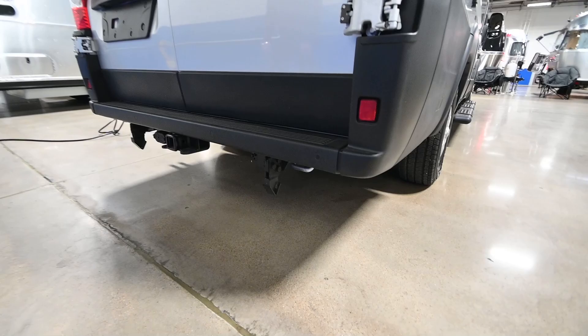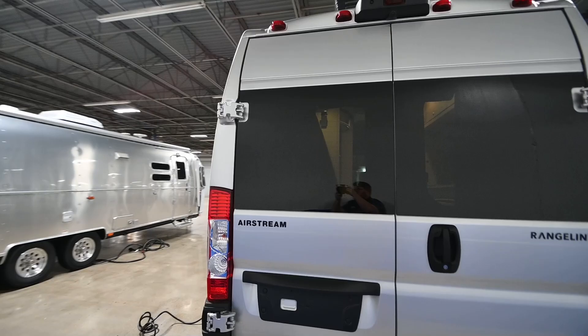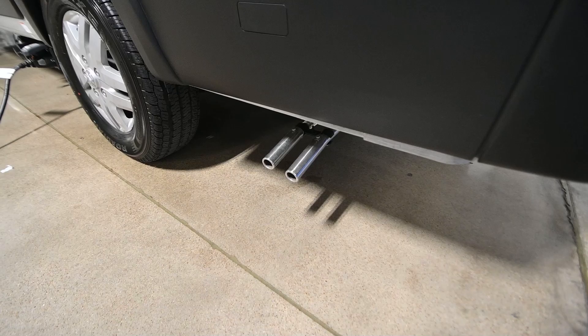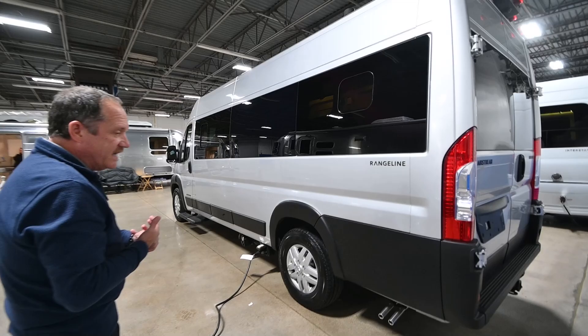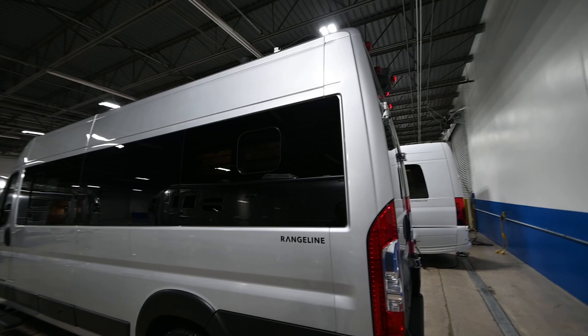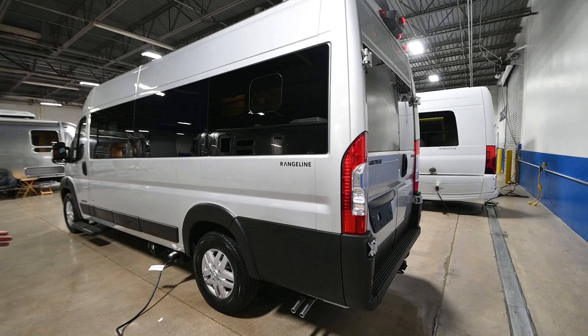As we walk around the driver's side, we're going to see a few things that stand out. We're going to see two exhaust pipes here. This is for our hydronic water heating system. We're going to have a heating system that works with an electrical element and also with a gasoline-fired burner. We also have our generator tailpipe there. We're going to have an Onan generator on board — a gasoline-powered generator — a little nicer than some of the other B-vans. Being powered with gasoline, it's easier for me to fill my fuel tank as opposed to a propane tank like we see on so many other Class B vans.